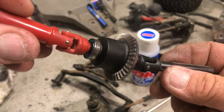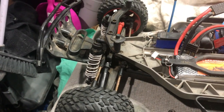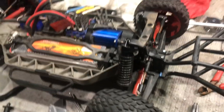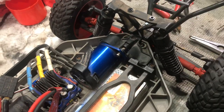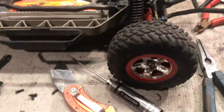The car is all back together. I've greased the rear and front differentials and put tacky grease on the pinion and crown wheel. I've also refilled and fixed all the shockers — running 60-weight oil front and rear. I've put new ball ends on and replaced a missing rubber diaphragm. They've got good rebound on them. All the wheel bearings were checked and are fine, and the shafts are sitting nice and straight.